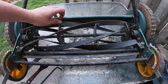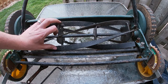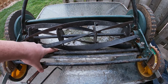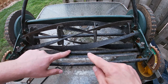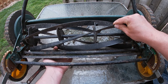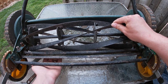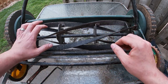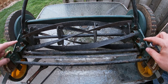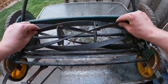In today's video I'm going to show you how to balance a blade on a reel type mower. This service will be similar for most brands of reel type mowers. You can see this cutting edge — this bar that goes all the way across — where the grass goes in between. This bar meets the blade and slices it. If it's not making enough contact, it won't cut the grass properly. Your main goal is to take your bolts and tighten them to lift up that bar so it makes a little bit more contact.